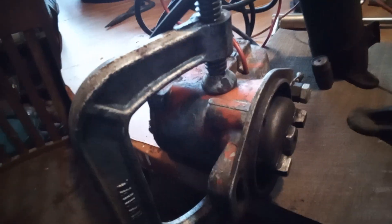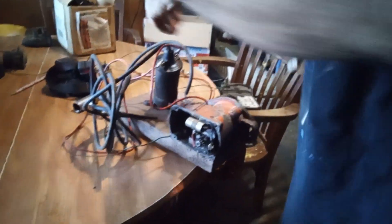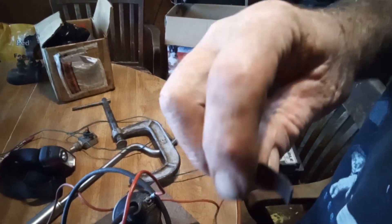I've run into that before. What I'll do is wire up a coil on them. I'll take this mag loose here for a second — I've gutted that mag. There's the coil that came out of it. There's a little wire that went from the coil over to the kill switch — see that little spring? You ground the coil out to kill it. And here's the cap off of it.